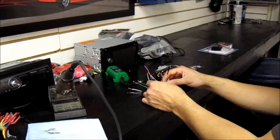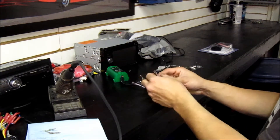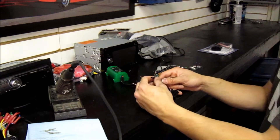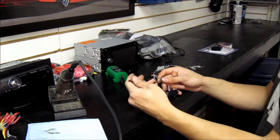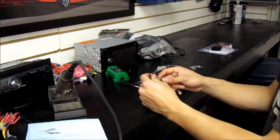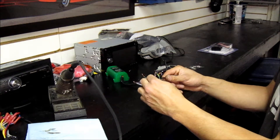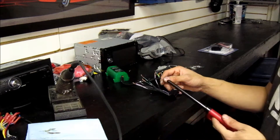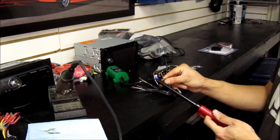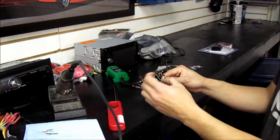For connections you're not going to use — in this case the reverse input and the pink wire — I'm going to try not using the vehicle speed sense. On some applications it's more accurate, but I've done plenty of installs without it. Think about it — portable GPS units and cell phones don't hook up to vehicle speed sense. When terminating an unused wire, if it fits in the shrink tube I like to fold it back, put the shrink tube over it, apply heat, and while the tip is still warm, close it off.